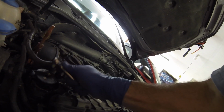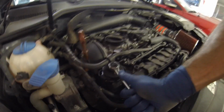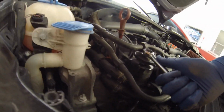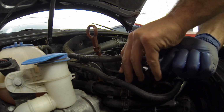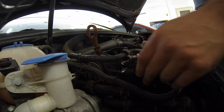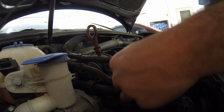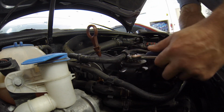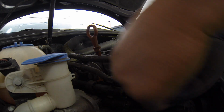This actually, when you put the socket on there and you crank on it, it tightens down on the filter and kind of crimps it. And the filter shouldn't be that hard to get undone. So this should have only been put on hand tight. This one's a little tight though. Alright, make sure my wrench isn't hitting on anything. Sometimes your filter wrench sides can hit on the housing back here. Looks like I've got it in the right spot. It's just on there, super tight.